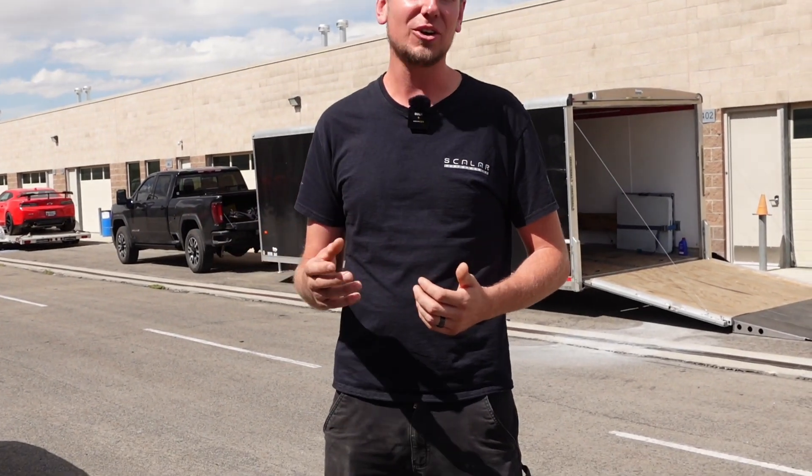We're being sensitive to the equipment and don't want to damage anything, but this is really neat. Even the dyno owner said he's never seen anything like this. We've gathered all the data we need, and now that temperatures are up — battery is around 50°C and the motor is at a nice operating range — we're going to try a hero pull to see what the power levels are at temp. We started at 25°C on pack temp, and this particular cell likes to see its maximum discharge rate at around 50–60°C, so we're going to do one more hero pull and then pack it up.